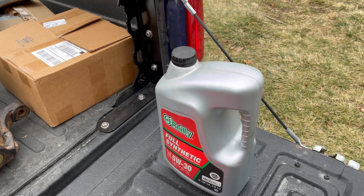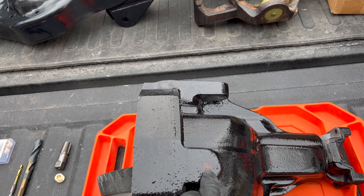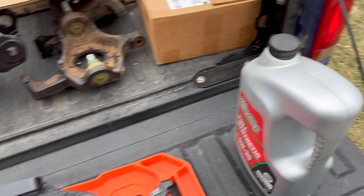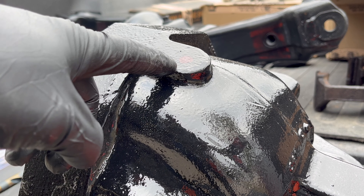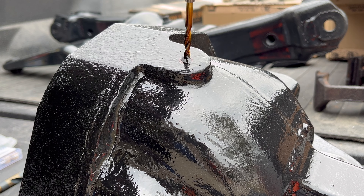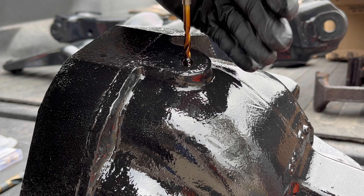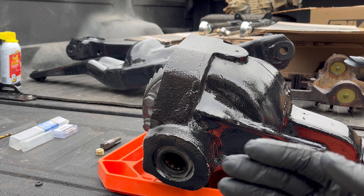I have a drill and some dirty oil. I'm going to start by drilling a little pilot hole with the much smaller drill bit, making sure the bit is lubricated with oil throughout. I'm set up, eyeballing my center, and drilling the pilot hole while trying to stay as straight on the work as possible.